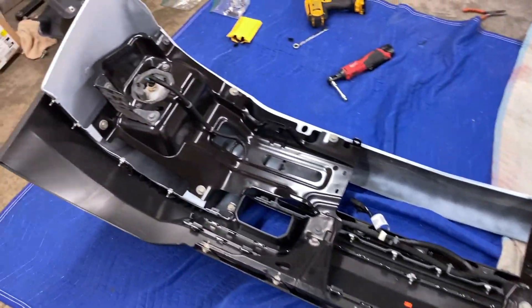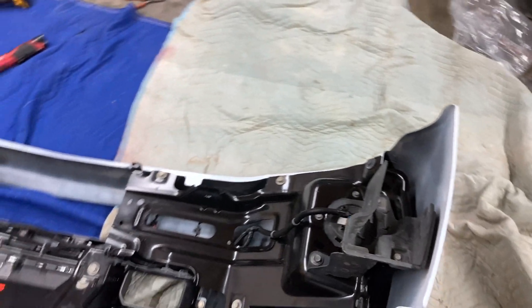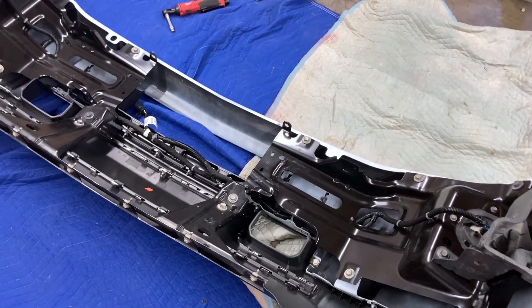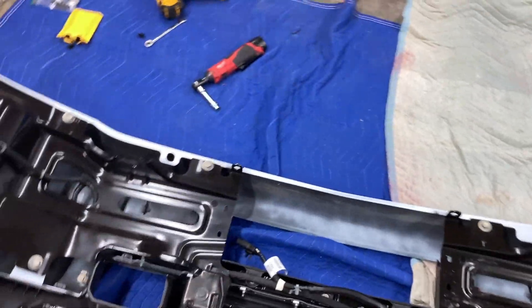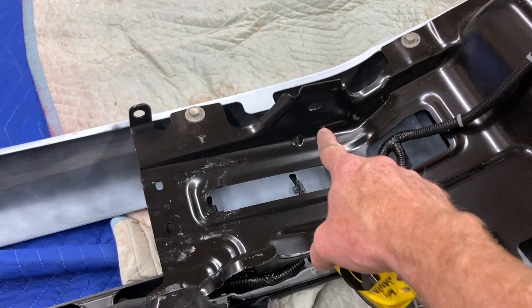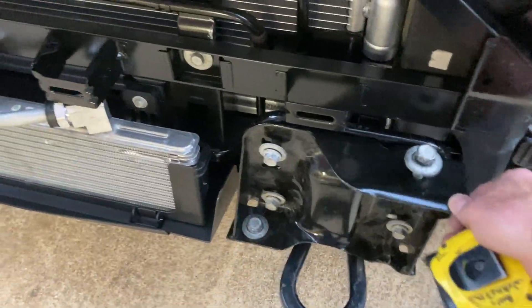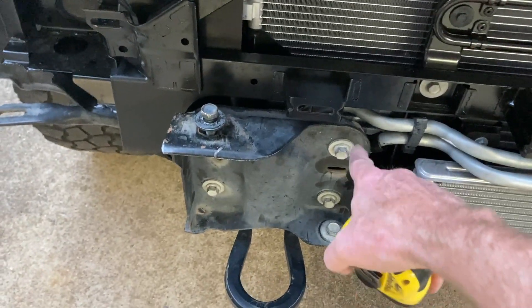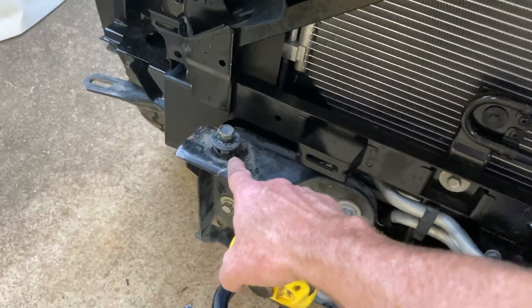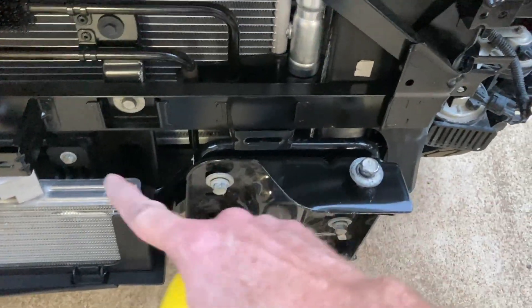Here is our completed bumper — they did a good job. When I flip it over you'll see it's a really nice looking bumper. I kind of like chrome ones just because I like the bling on the front of a truck, but these look good painted too. What I need to do now is measure the distance between those two mounting holes — we had to replace the collar on one side, so I need to make sure I get the same distance. The other side is bolted in the exact same spot as factory. I measured it at 38 and a half inches, so I'll measure from that bolt to here and tighten everything down to exactly 38.5 inches bolt to bolt.